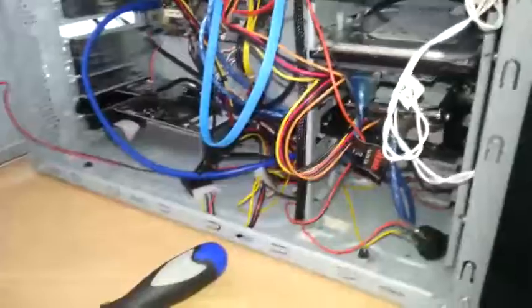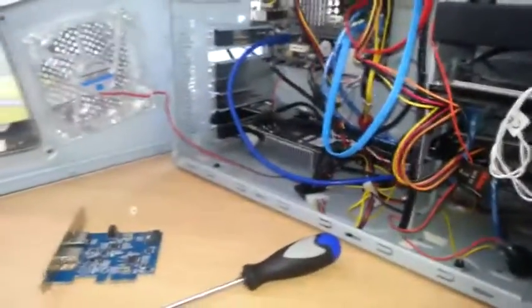When I plug it in I'm going to show you it just doesn't work. Now I've got the card in the PCIe slot with a SATA 3 cable connected up to the solid state drive. Nothing's wrong with the solid state drive — it works because I connected it to the SATA 2 port and confirmed that. I've also tried an additional drive like the DVD writer and it still doesn't work. So this is what happens when I switch it on.